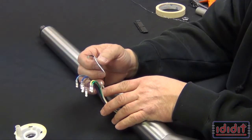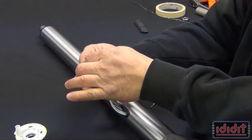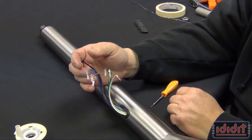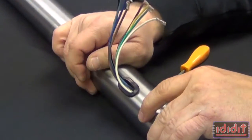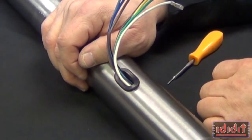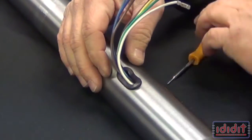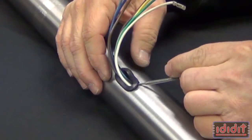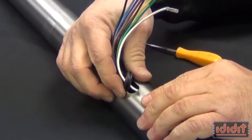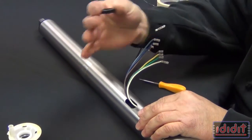We want to take the sticker off the negative side of the relay — just rip that right off of there. We also need to remove the grommet that is at the wire hole. We can simply do that by putting our poker in there and kind of lifting up on it and working it right out, then removing that right off the top of the wires.